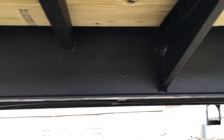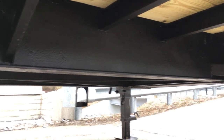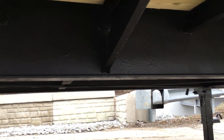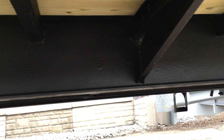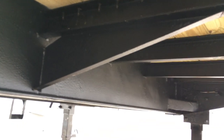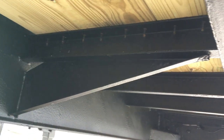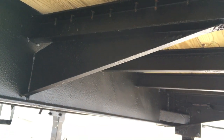Also on the underside of the trailer, you'll notice ShoreTrak undercoats. This is something we're not aware of anybody else doing — it makes the trailer very durable. We saw several of the trailers we sold several years ago, and the underside of their trailers stays pretty nice with the undercoating. Definitely a lot more durable than paint. You'll also notice the outriggers they use are not angle iron as we see a lot in the industry — these are actually similar to your semi-style bracing going out to the outer side rail.